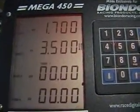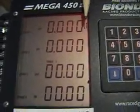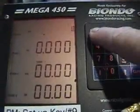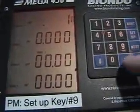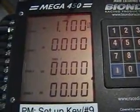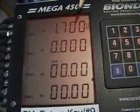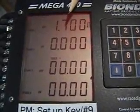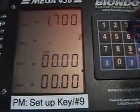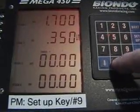Okay, this is the next screen for your throttle stop — Stage 1. You'll set it using the arrows here. What you're going to do is hit the clear button. Let's say you want 1.7 seconds — hit 1.7, zero, zero, with the decimal point there. Remember, this is including the delay. So the delay was 1.03, and after that you'll have 1.7 seconds before this thing comes on the stop. Then for the next value, hit clear — this is when you want the stop to come off. We'll say 3.5 seconds, and there you go.